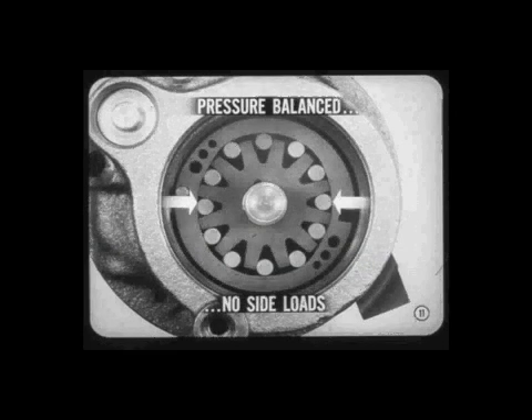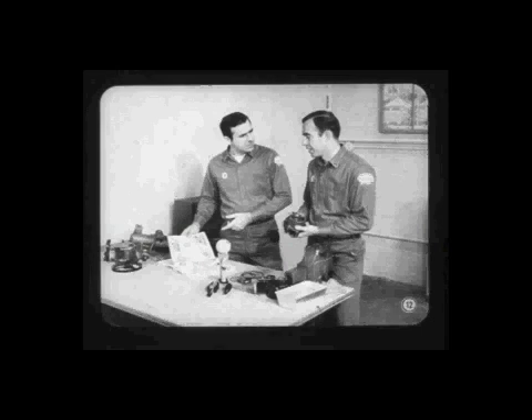There are also two outlet or discharge ports. At these outlet pressure points, the cam ring pushes the rollers into their V grooves — the rollers literally squeeze the pump fluid out of the V grooves and into the pump discharge ports. Since the two pressure chambers are directly opposite each other, they balance out the radial loads on the rotor. As a result, there are no hydraulic side loads on the pump shaft and bearings.